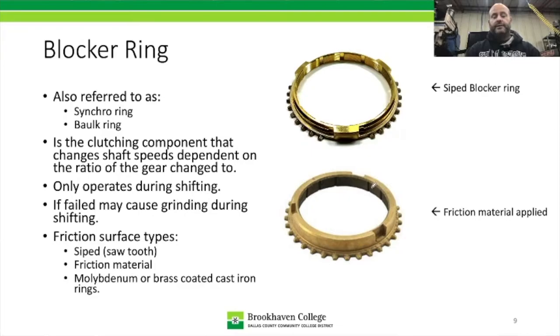And then we have another one here, which is a friction material applied to the inside of the blocker ring. There are some other ones where the ring will actually be made out of cast iron or steel, and on the inside of it, they'll spray on either molybdenum, which is a metal that they can melt, and it will spray it on as if it was kind of like welding it on there, and they can do the same thing with brass or bronze. So there's different types of blocker rings out there. There's another type which actually has more than one blocker ring in a sense, but we'll get to that one in a minute. Okay, so I'm going to come over here to the table